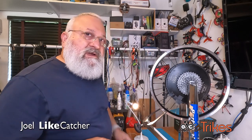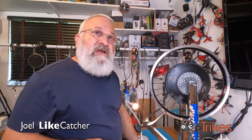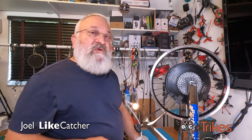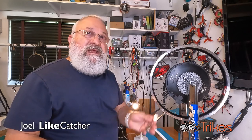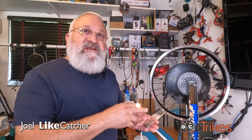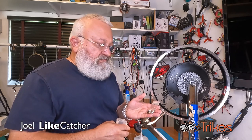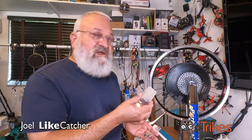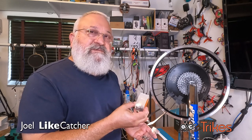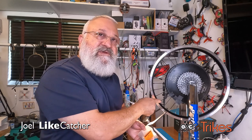Also, I want to give a shout out to one of my people I respect in the bike industry. His name is Eric. He works at Durango Bike Shops in Pembroke Pines, Florida. And we were talking about spoke nipples. He said to me, these aluminum nipples, not good in South Florida where I am. They're soft, and as you make the spoke tight, these threads can actually get deformed. And he recommended I go with the brass nipples, which I was thinking about because brass is a much harder material and less likely to deform and round and stretch out and break like this nipple did over here.